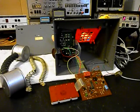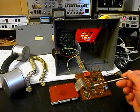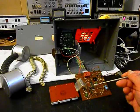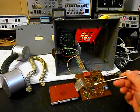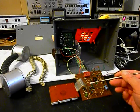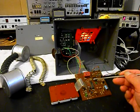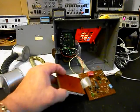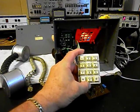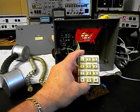Now this gives you a look at the main PC board. We have an IC on that main PC board, and it's an LR40992. That's a pulse dialer, and it's a CMOS IC. So this telephone only dials out in the pulse rotary signal. And then we have our keypad. What we need to do is change PC boards, because we want to dial out in the touch tone mode.